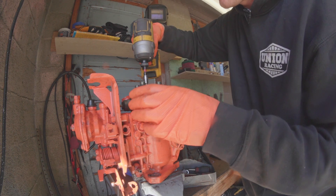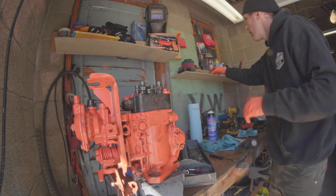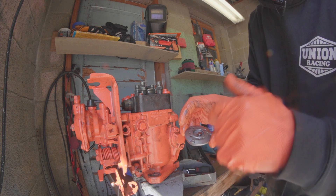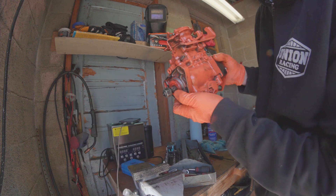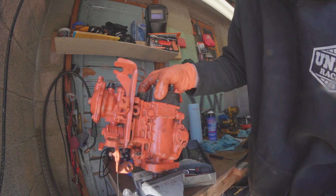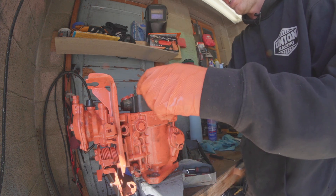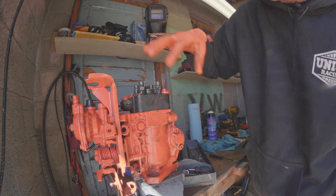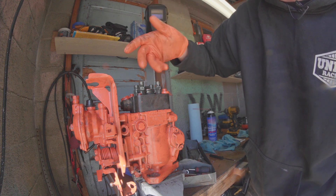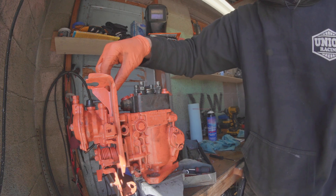It's worth mentioning: if you take your pump apart, take note of where the cam plate is, because this is what determines your timing and it is possible to be 180 degrees out. The other check for being 180 degrees out is the keyway - this thing right here should line up with the position you put the cam plate in. Mine does, so we're good to go. Now I'm going to torque this, clean it up, put the pump pulley back on, and turn it by hand to make sure everything's good inside. We also need to put the power screw back in.